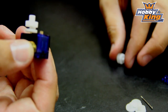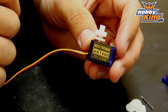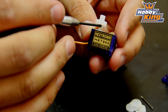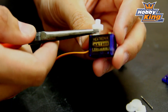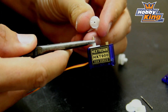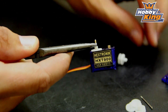The slightly more difficult part is removing the top gear, because it's actually a little bit of a press fit. The bottom one actually floats, so you can push that down a touch, which gives you access to the little metal spindle. Use needle nose pliers to grab the spindle itself, obviously without destroying any of the gears, and you need to actually tug on this pretty good to get that piece off. That piece is a press fit — it's the only one that is a full press fit and it's not allowed to spin, so you can set that aside.